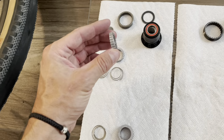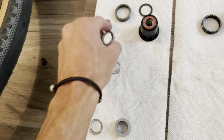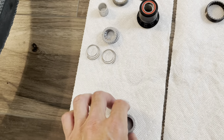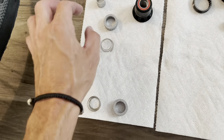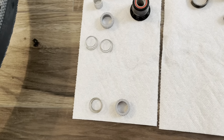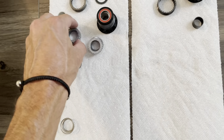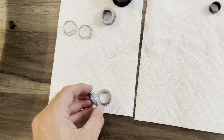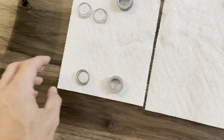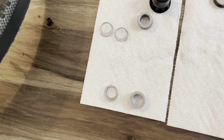The 18-tooth comes with the kit. It is not an SL — you can see that because the inside is solid where the SL is hollowed out, making it definitely lighter weight. My strategy with the ratchets is that I like the serviceability — no tools needed to service them on the road or trail. I'm going to install the 54-tooth but keep the 18-tooth pre-greased, wrapped in electrical tape so nothing contaminates the grease, along with both springs in my spare kit. That way I have full backups ready to go.